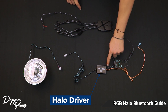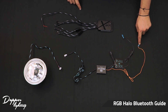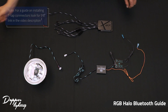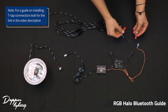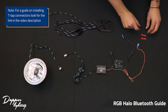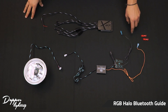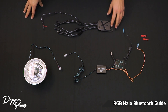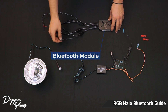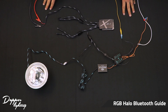From there you're going to have two extra wires. That first one is for your turn signal — you're going to hook that up to your turn signal power wire and you'll have a little t-tap connector that that'll go into. If you don't know how to install the t-tap, look for a video link in the description. The next one is going to be the ground for that halo turn signal, and then you're going to have this black connector which is the one that plugs into the Bluetooth module. That's pretty much it for wiring, so let's go ahead and jump to the next step.